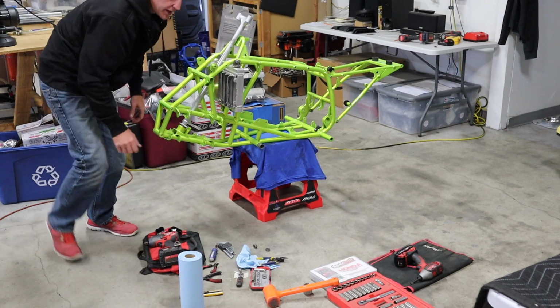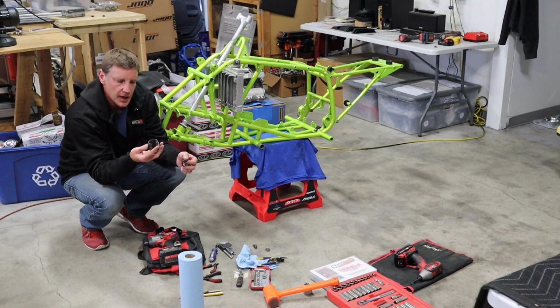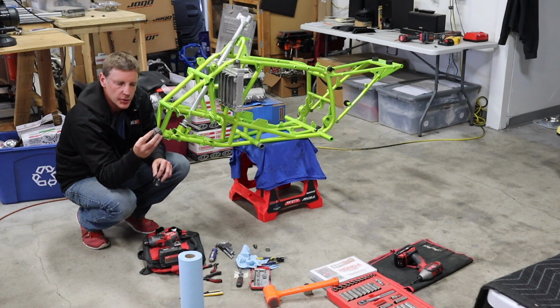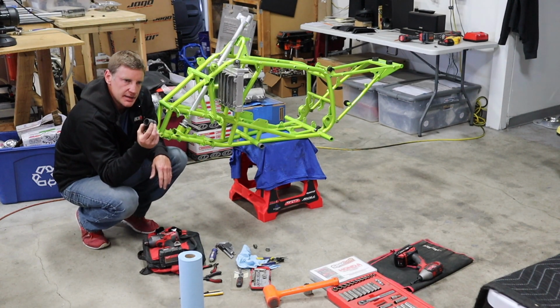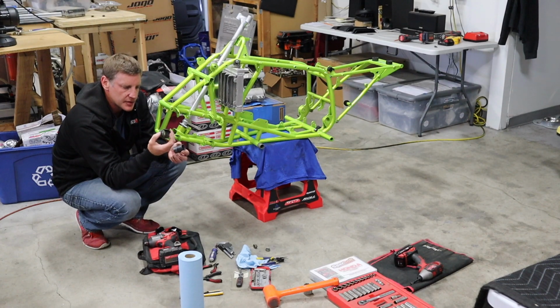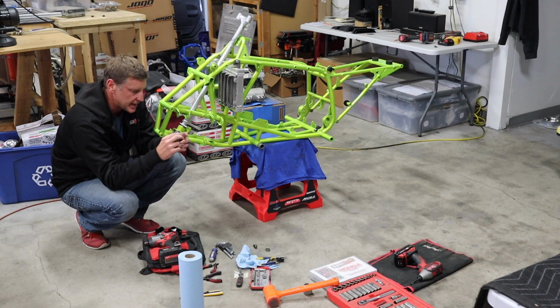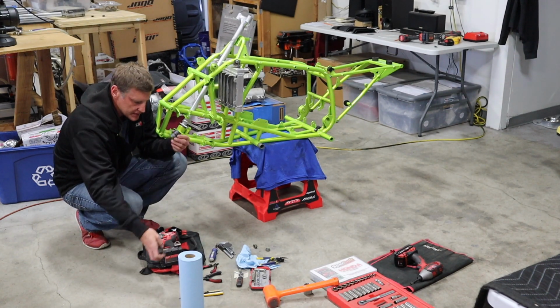And then, the other thing I forgot is the bushing. So there's two style bushings for the 250R. You've got this OEM style that just has one slit, pry it open and put it on. It's got a Teflon coating inside. And then you've got a two-piece. And I want to say Nax made this, but I don't remember. But basically, I think this is Delrin, so it's going to last pretty much forever, whereas these OEM ones will wear out over time. So either one, you can't buy these Nax, if it is Nax, you can't buy these anymore. I have a few of them off of takeoffs from other quads. So I'm going to use that in this.